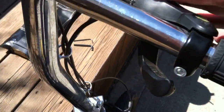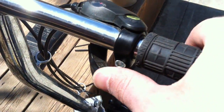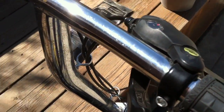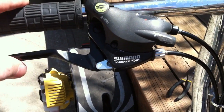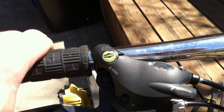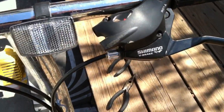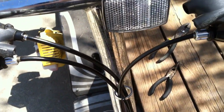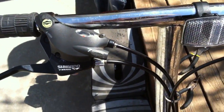This is actually the brake and shifter from a Schwinn mountain bike. We converted the shifting lever into a throttle lever, and used the mountain bike's brake lever as the rear brake. The shifter is the throttle. On the other side, we took the shift lever off — basically just using the brake lever so it matches the other side.